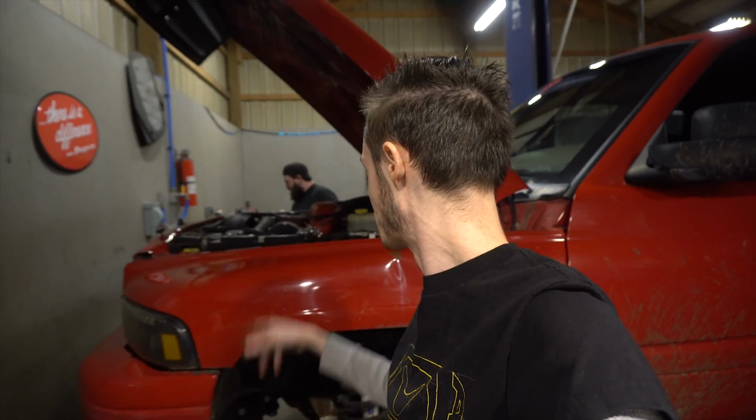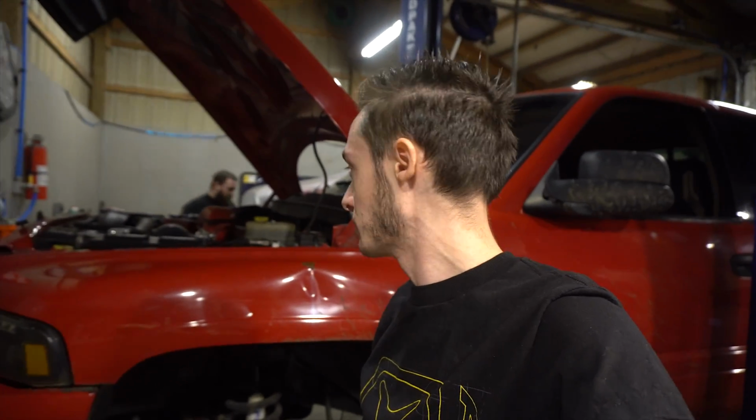Alright, now that we got those fresh batteries installed and those nice military spec diesel battery terminals, and we put some new ends on a couple of these because they were full of corrosion. Shrink tube them. We use some shrink tube that has glue in it, so it heats up and shrinks, and the glue comes out and seals it up. Excellent for corrosion resistance.